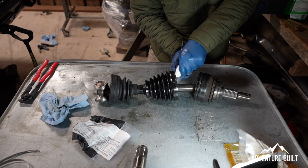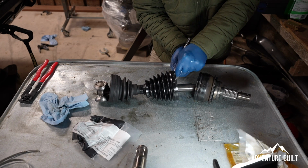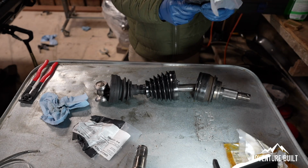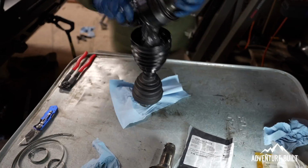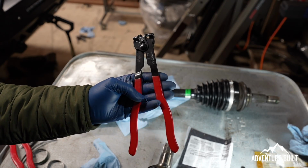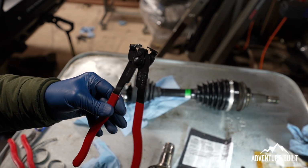So now I'm going to be adding the black grease to the outer, which is closest to the wheel. And you really want to try to use all the grease in these packets. We're going to need one of these ring tools to get the clamps on these rings actually cinched up. Link in the description below.